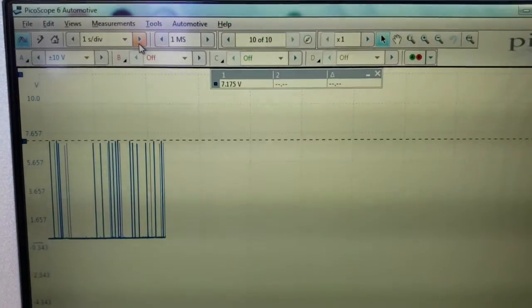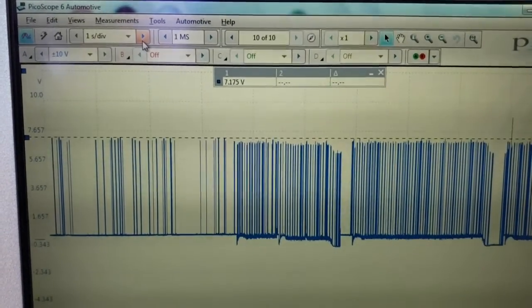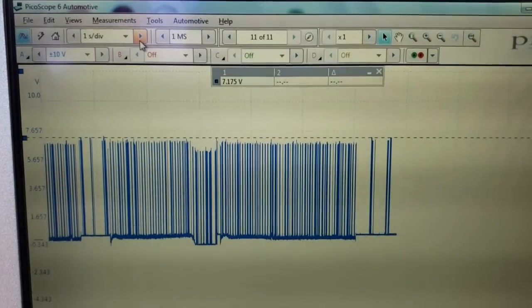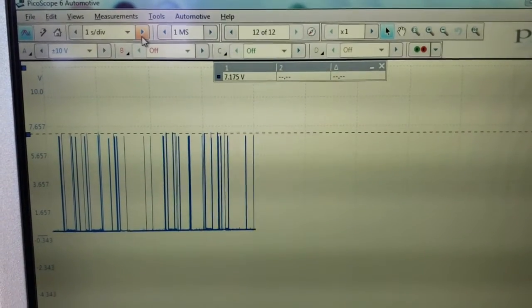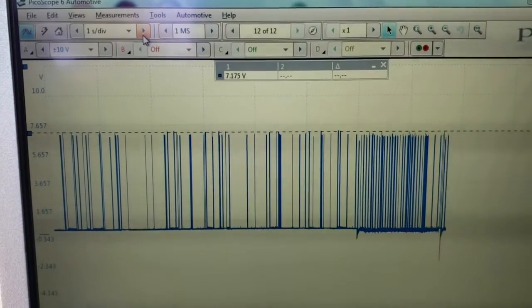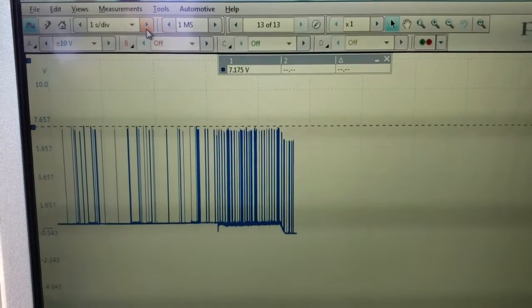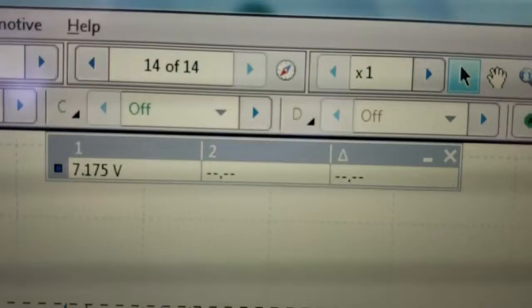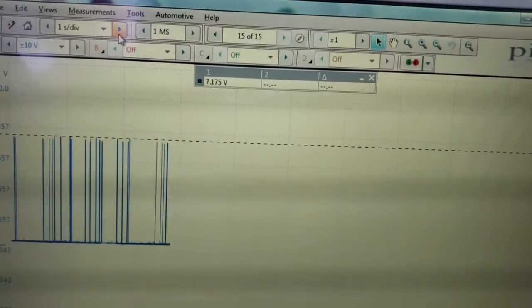Now I'm going to activate the power window. There is some voltage drop there on the center, we can see that, because I am connected to that ground for the motor. No message. That one is only a signal sent out for diagnostic purposes of the circuit. Release. No message being sent out. Message being sent out. Okay, so that's how it works. About 7 volts, as we can see here. 0 to 7 volts is basically how this system works, the class 2 network on these GMs.